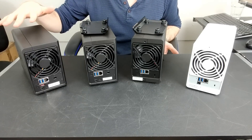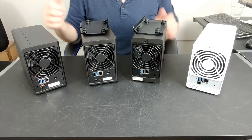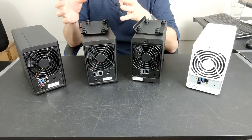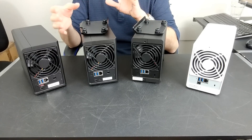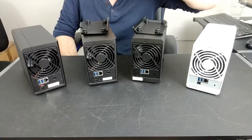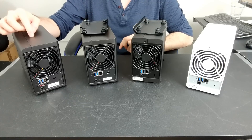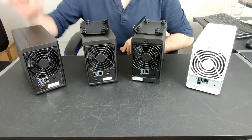All of these devices will back up to a third-party cloud platform and use all those great apps, but the data inside your device has to be safe — that's where encryption comes in. All these devices support encryption, but the DS218+ runs a faster, better version. When encrypting files and data in transit it uses a lot of system resources, and a less efficient encryption system like AES-256 on the lower-end devices will give you lower read-write speeds with encryption enabled. The DS218+ supports AES-NI — the new instruction encryption system — which means it encrypts to the same safe degree using fewer system resources and faster too, so you'll see less of a performance dip.